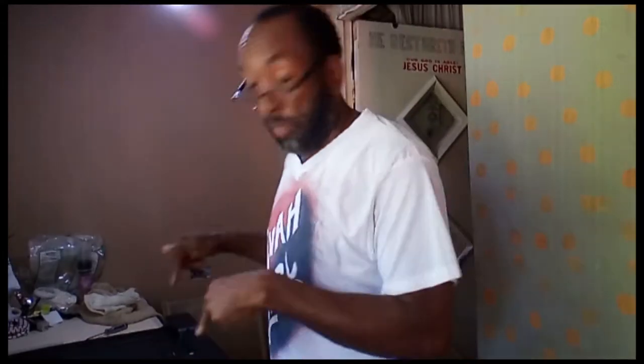When you turn your TV on and you see the logo, the name of the TV, flash on screen, then the TV goes back dark, the screen goes back dark, but the TV is still on, you have a backlight problem, all right? So right now in front of me here, I have a Toshiba 49-inch TV. It is the same problem.